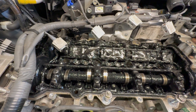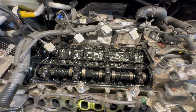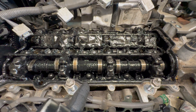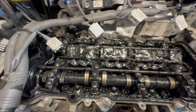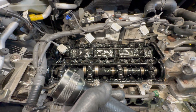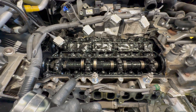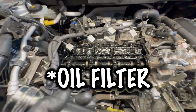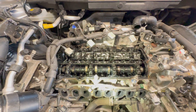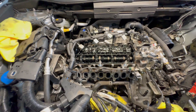To be honest, this is what I expected based on what I've seen on the bottom of the engine. Look at those bubble balls around the cylinder head bolts and all that jelly — it's very thick. The injector washers weren't blowing out, so the strainer was not blocked that way, but all this jelly sludge also blocked the strainer.